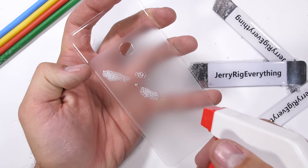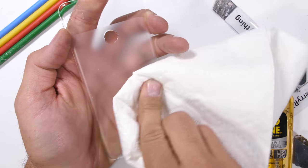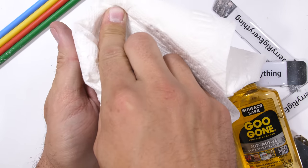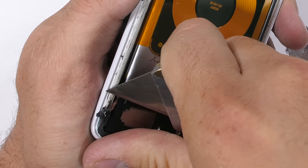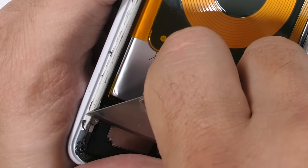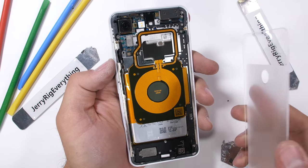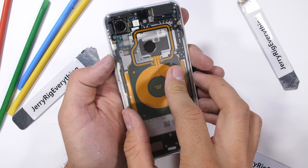After the last bit of tedious color removal around the fragile glass corners, the phone is clear and I still have all my fingers — thumbs up for that. A little bit of Goo Gone and glass cleaner clears up any residue and fingerprints. I'll dust up the white Pixel snowstorm I created and remove any leftover black adhesive on the phone body to make sure it looks clean from the inside. It's starting to look pretty awesome — it's almost like Google knew I was going to do this, because literally nothing had to be modified, removed, or cut inside the phone for this to look absolutely amazing.